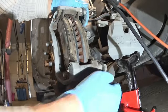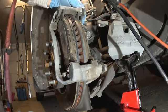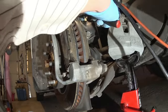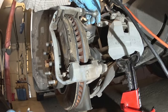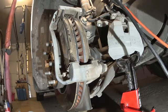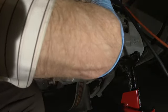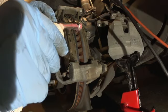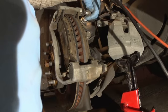Those caliper pins — I can't even remove them, they're stuck, and they should not be like that. They should be freely movable. I'm going to gently push on them to get them out. Sometimes you have to use a wrench to twist them and break them loose. It depends when's the last time someone serviced them. I'm going to use a little bit of grease — put it inside, apply it to the pin itself, and just twist them so it gets lubricated.